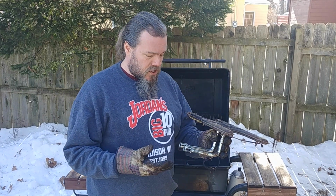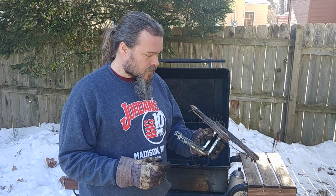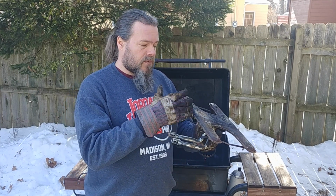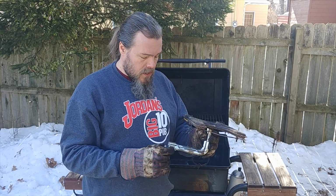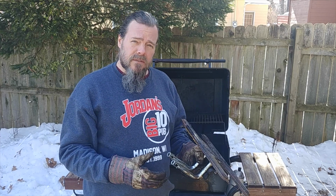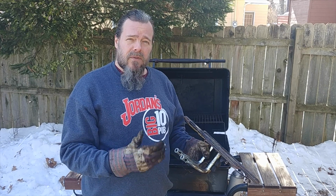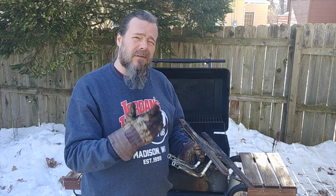But what we want to do is change how low the lowest setting can be, and it has these Venturi tubes that feed the 2 separate sides of the gas burner, where flames will be underneath here. There are these brass orifices on the fittings underneath the grill, and we'll modify them to have different characteristics, so the lower BTU burner is a little higher than it is now.